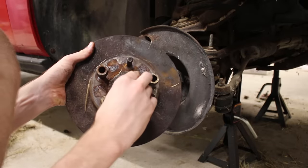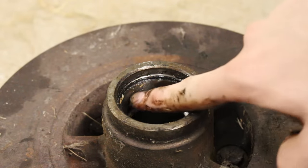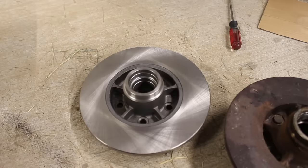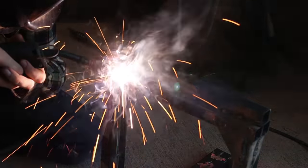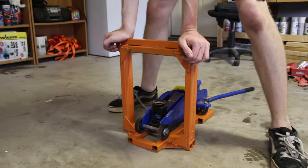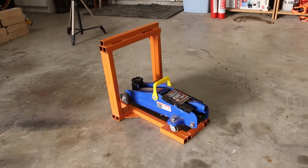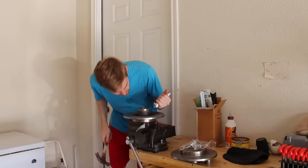There's also a cap to keep out dust and water. Unfortunately, the new front rotors are not as easy to install as the new rear ones. The tapered roller bearings roll around on bearing races and they're pressed into place — they have to go all the way down to a little lip that's visible, and it's not as easy as them just falling into place. There was going to be a separate Saturday Projects video showing how I made a DIY hydraulic press with a car jack, but it failed terribly — it didn't handle any force before warping completely. There most definitely should have been a beam going all the way across the bottom, and more importantly a brain in my head when I made this. So, it's back to the primitive yet effective hammer and Autozone bearing race installer kit.